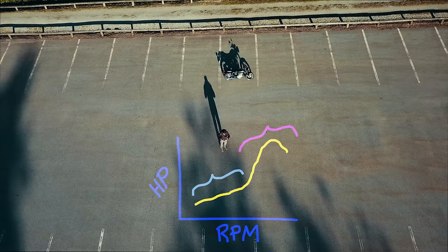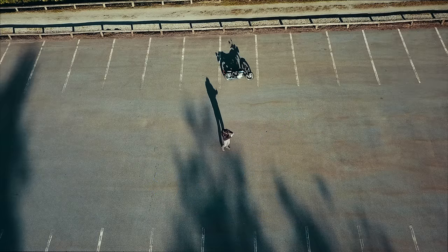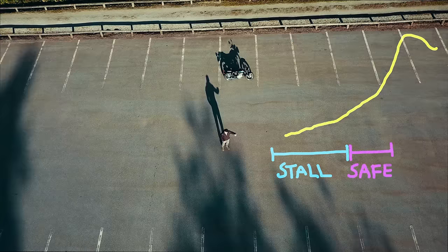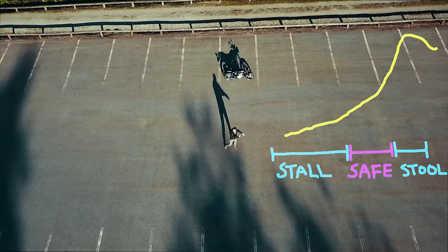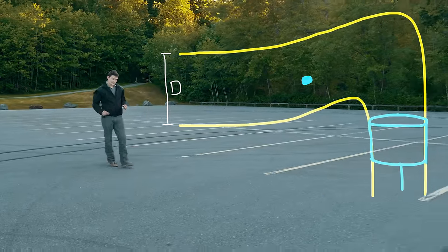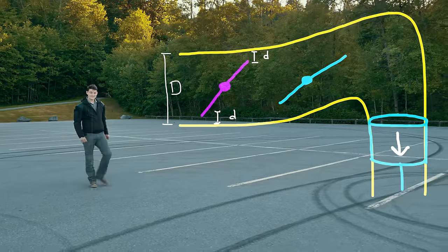A skilled rider will know to work the gearbox up here in the power band, but for beginners, this is a difficult mountain to climb. You get lost in low power and stall, or your shaky wrist jerks you into wet underwear territory. So Suzuki introduced a second throttle valve. This narrows the intake diameter to increase airflow at low cylinder speed.